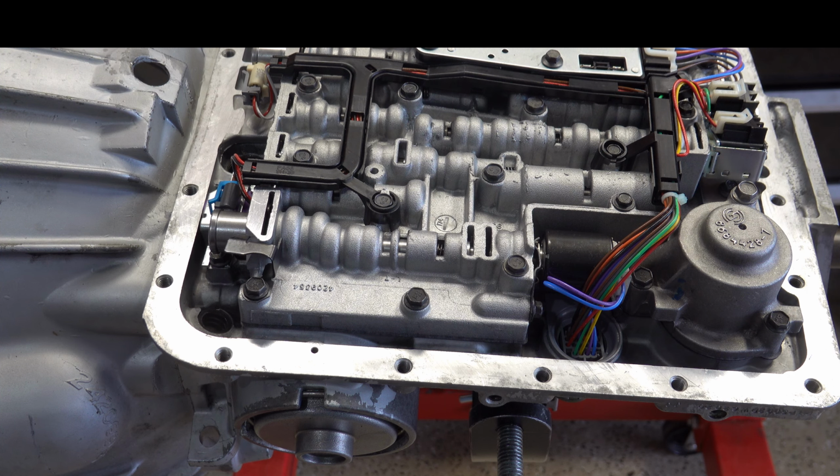One of the ways we do that is we check for servo travel either on reassembly or while the transmission is in the vehicle, whether just during the course of assembly to make sure we get everything right, or if the transmission is still in the vehicle, we're either installing a different servo assembly, or we're trying to diagnose a late harsh 1-2 shift condition, maybe even coupled with a 3-2 downshift flare that isn't attributable to trouble code P1870 or a broken 1-2 outer accumulator spring.